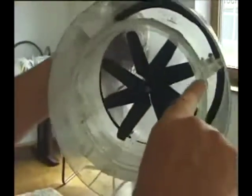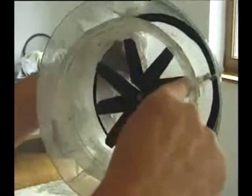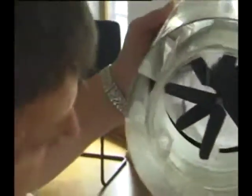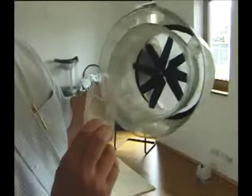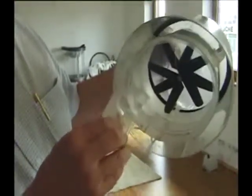Here you can see the propeller. Here the helical vane, which guides the dirt and dust particles, creating a centrifugal force to propel them into the extraction port. The dirt and dust runs once around the guide vane and exits here into the collector box, which slides and clips into place.